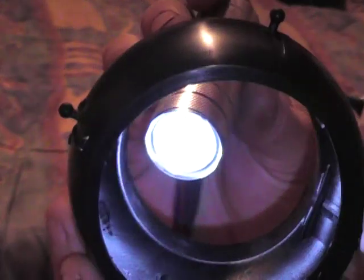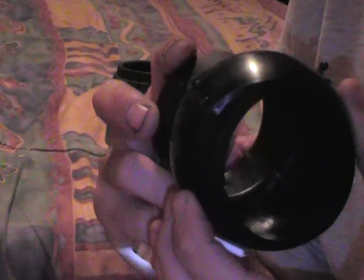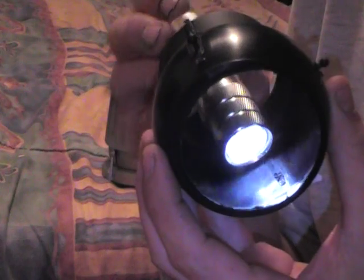Here's the standard ball. Looking down inside with a flashlight from the intake side, you can see the disturbance right down in here — this big hollow area that's part of the ball socket, part of the design. That's part of our efficiency problem. A way to improve that is what I've done here.